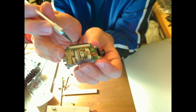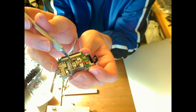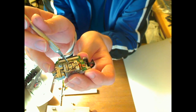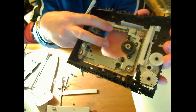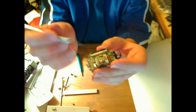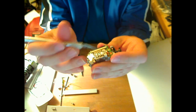This is the focusing lens assembly — there are little magnets and coils of wire in there. It moves up and down to focus the laser on the disc, and side to side to position the head more accurately. Because the stepper motor is a worm-drive and not accurate enough for those tiny tracks on the disc, this assembly moves just a tiny bit to find the actual track it's looking for.